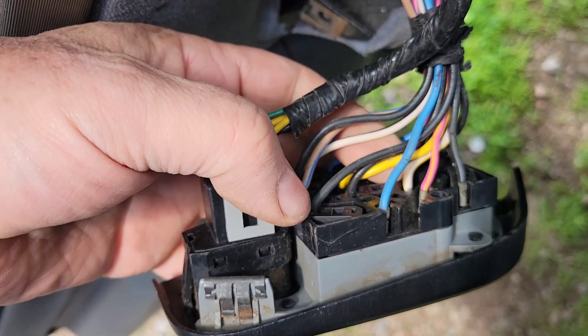Once I get that part number I'm going to order the electric motor. Diagnosed — not repaired yet, but that's where we're at. I can put that side back together; it's not on that side, and I've deduced it is in fact the motor on this side. You know what you can do when you actually have a proper test light and tools. One of my colleagues at work said, back when this all started — what are the odds the motor went on the other side? And then I put a brand new window regulator with motor in and that motor stopped receiving commands.